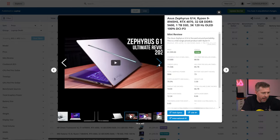If you want to apply these settings, you do have to click the little check mark and then it will apply. When the fan profile curve is all up at the top up here, it means that the fan will run at 100% max fans. If I set a curve more like this, it's only going to ramp the fans if the temperature of the laptop gets hotter. So this is more of a traditional fan curve. For example, if you want max fans, just raise the first one up to the top and it will set max fans. Now, in terms of, you know what we can do too?